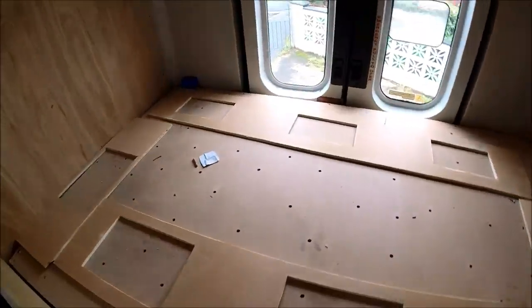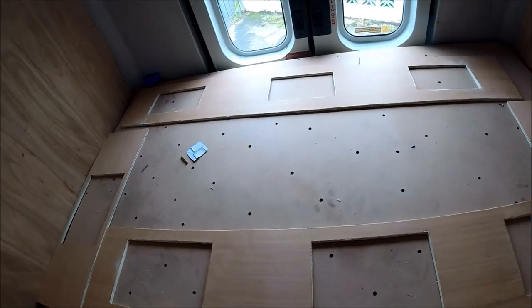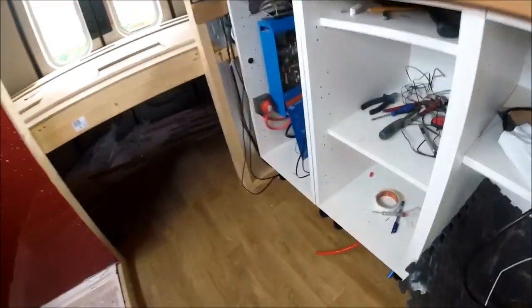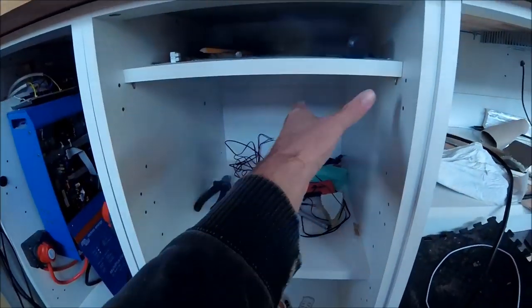At the back I've got a full small double bed on ottoman lifting hinges, so a push of a finger lifts the full bed frame up to give full access underneath for storage. I'm also in the middle of getting the water pumps and water accumulator wired in. All the water piping is fed underneath the bus coming out where needed — I've got a cold feed for what's going to be a Thetford C200 electric toilet, a cold feed for the hot water, and hot and cold water coming up for where an under-mounted sink will go.